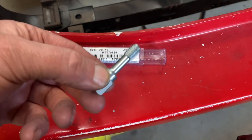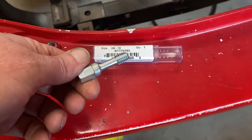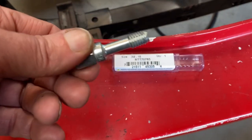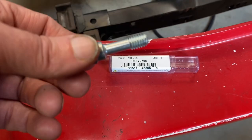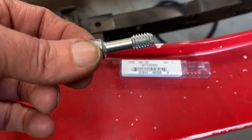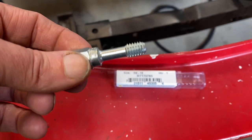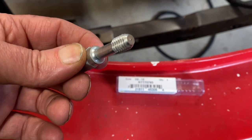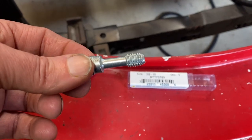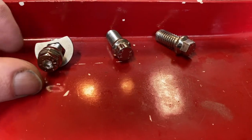I recommend you spend a short amount of money — five or ten bucks — and get a 3/8-16 thread chaser. Even with brand new heads, make sure you clean out all your header bolt holes. If you don't, Murphy's Law says it'll be the one in the back. Sometimes these bolts can drag a little, especially with the header and gasket in between. The 3/8-16 is used quite commonly in many locations on a Ford motor, so it's money well spent.